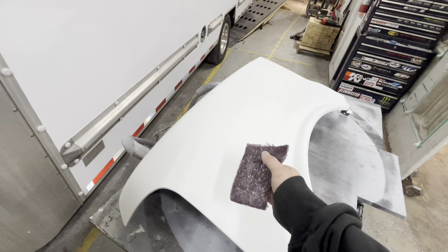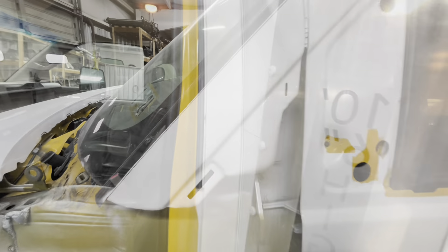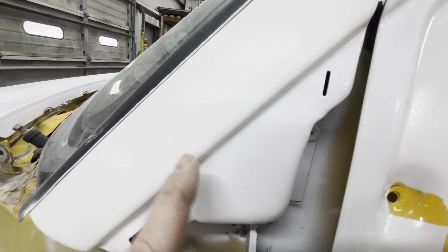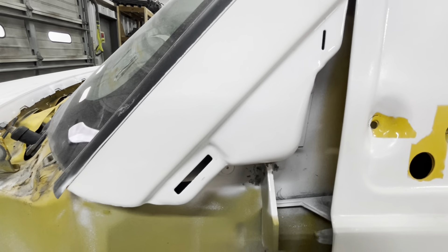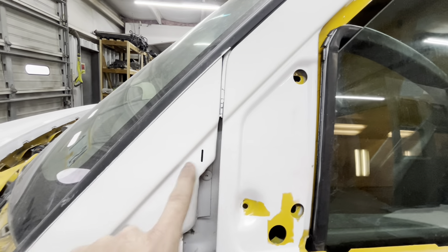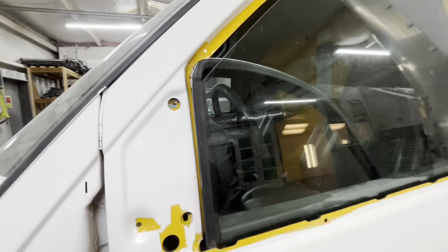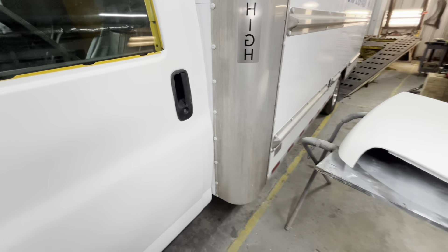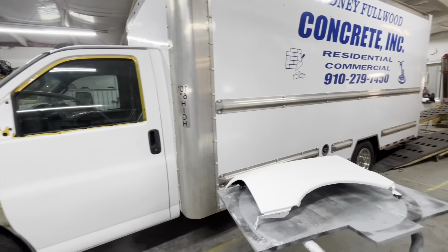We could be fighting with the same thing we did on the two-tone F-150 job. You can see how crappy this is — paint all over the seals, it's just a cheap work truck job. The color is creamy-goldish-yellowish versus how white the original was, and we didn't repaint these areas so you can really see the difference. My fault — I didn't write down the paint code, I just wrote GM white because that's what we normally spray, and for some reason it just doesn't match. Not everything works out perfect every single time, even when you do it for a living.